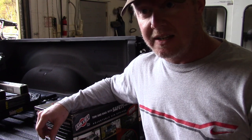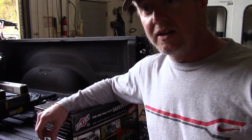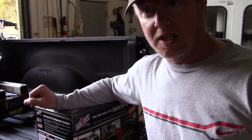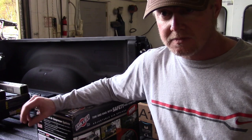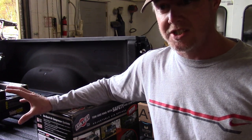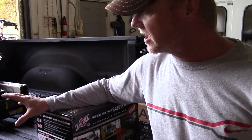truck. And I'm going to shoot another video after I get done with this where I'm actually going to use my load scale and measure the tires. It won't be an exact science, but what I'd expect to happen is I'll actually end up with a little bit more pressure on the rear. The heaviest pin weight or tongue weight that I have is probably the fifth wheel, and I'm just shy of 2,000 pounds of pin weight, about 1980 with a full load of water, which is within the capacity of this truck.